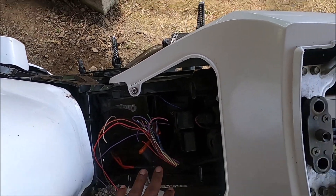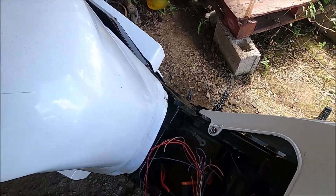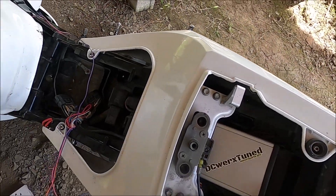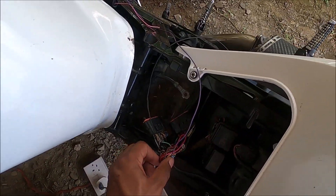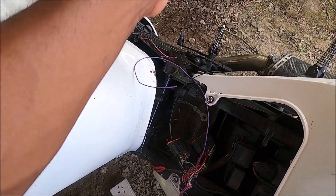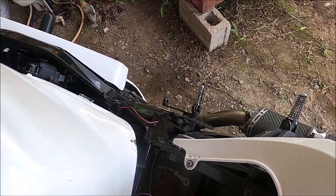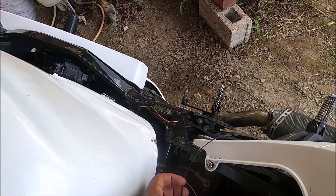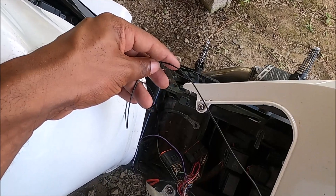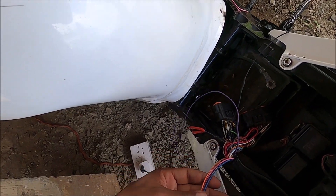I actually have one wire that goes all the way to the front to the kill switch. My good friend Mike reminded me to make sure I get the video clips, since I never record anything. Picking up right where we left off — I have most of the harness spliced in. These two wires: purple will be going to the wideband sensor, so I need to install a bung for that. The other goes to the ECU from the wideband and the kill switch, so we can do two-step and all that.